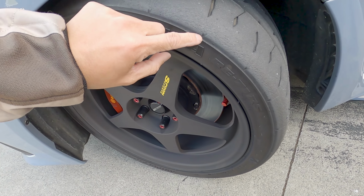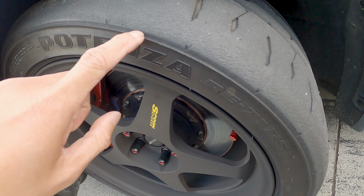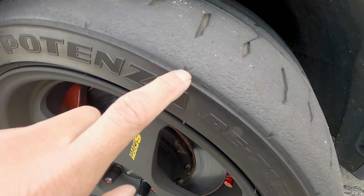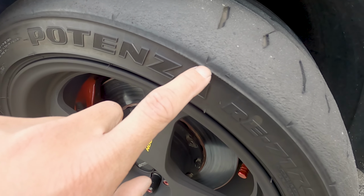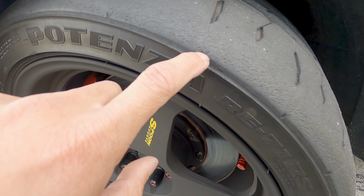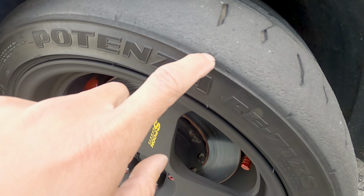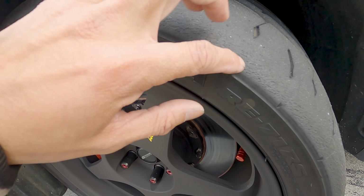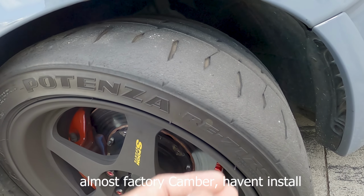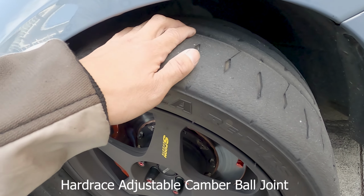After I've driven it, the tyres actually folded over that much. It's on the borderline or the limit. If you go over here, then you are turning in too fast and understeering too much. So we're kind of on the limit already on the cornering speed. When you drove before, it didn't look like this. So the tyre was actually starting to fold over. Still probably good enough for another track day.